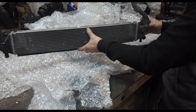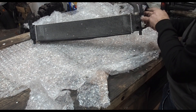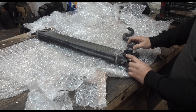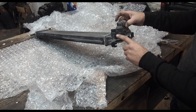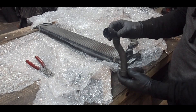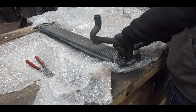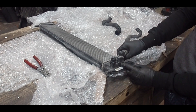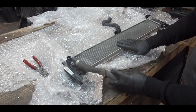This shape will slide in, and on the top there are quite a few things I can drill a hole and bolt something up. It's also got one pipe in it already. Looking at these fittings, they look like Mark 4 stuff. I've got some Mark 4 pipes - let me take one off and see if they're going to fit these push-on clip fittings. I took this off an engine I had laying around - it's the Mark 4 type clip - and it does fit. I'm quite stoked about that. So now let's move it over to the car and see where we can mount it up.